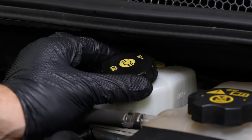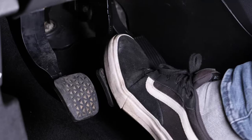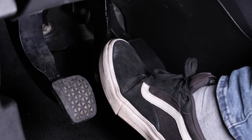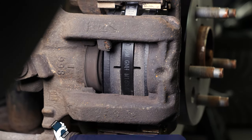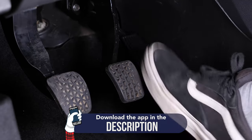Be careful. Before using your vehicle again, start your car and pump the brake pedal a few times to bring the brake pads together again. Try to drive smoothly and avoid sudden braking for the first 50 km or so to avoid glazing the new pads. Operation completed.